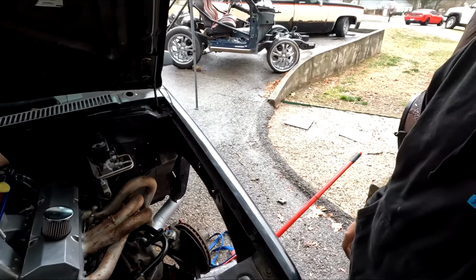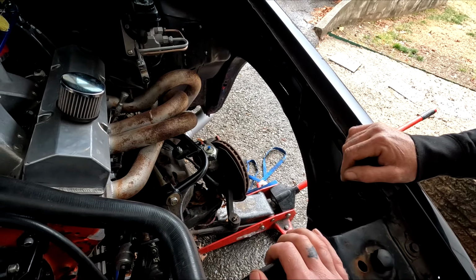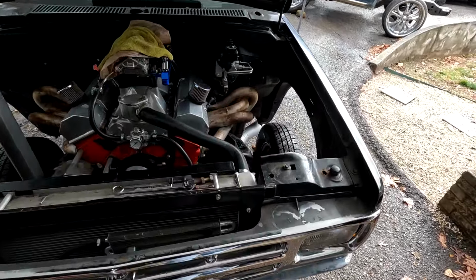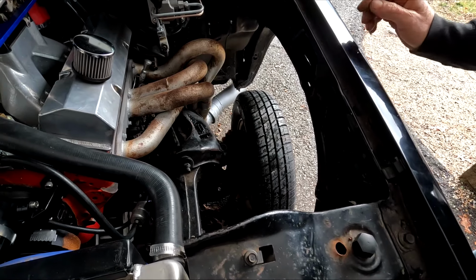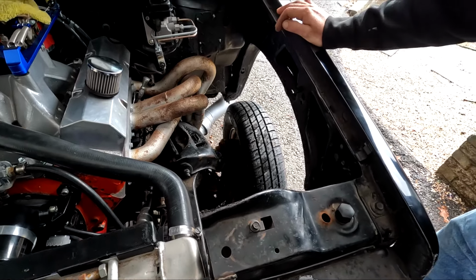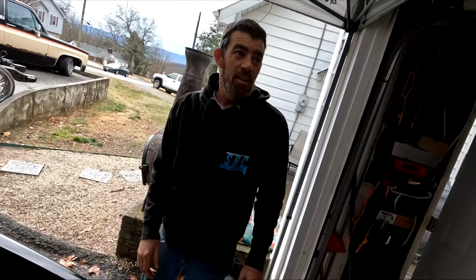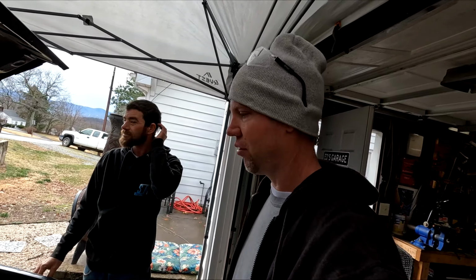Who the hell come up with that high rod stand? That's some garbage. That's for a cruiser. That's not for no drag truck. We just put the factory arm on. That looks a lot better. Just even looking at it. Yeah. So lesson learned. Those little tubular Chinese arms are garbage.